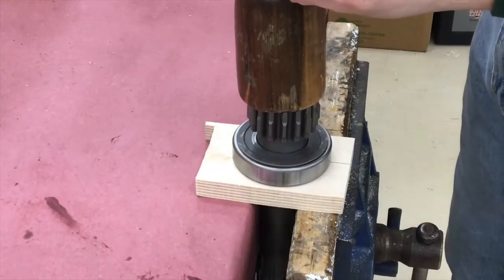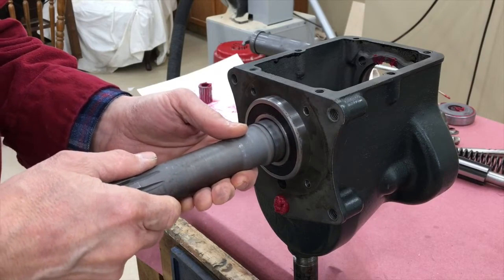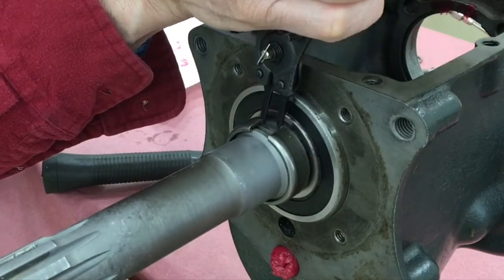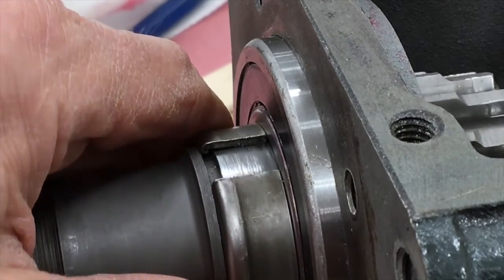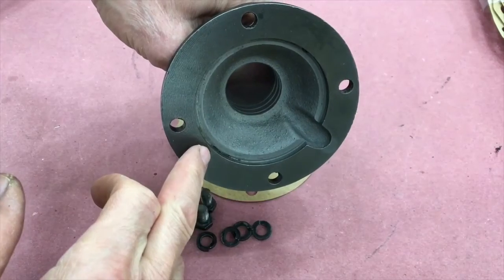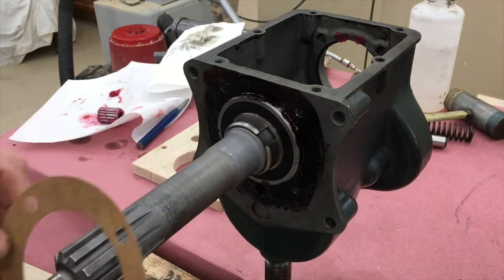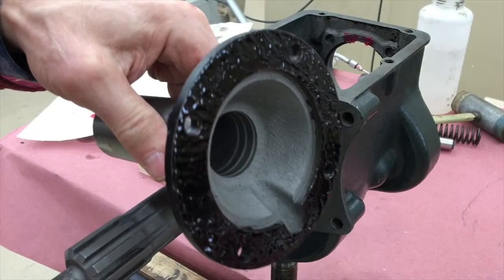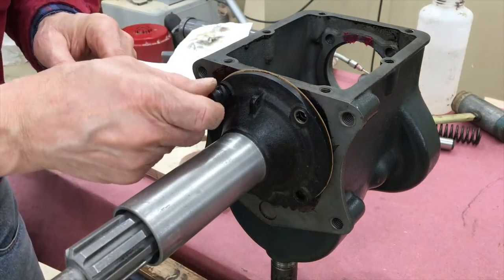I am putting on the bearing for the main drive shaft, making sure to support the inner race, then slide the bearing into the casting. This is the main drive gear snap ring — it fits in a groove on the main drive gear shaft. Make sure this ring seats properly and that it is tight enough so that it spins with the shaft. This is the retainer for the main drive gear bearing and it locks the outer race to the casting. I put some tacky gasket sealant on both sides of the gasket — probably not necessary, but I'm doing everything I can to prevent oil leaks. Make sure the drain slot is on the bottom and the hole for the throwout bearing spring is on the top. Four bolts with lock washers.